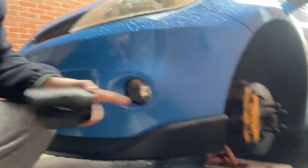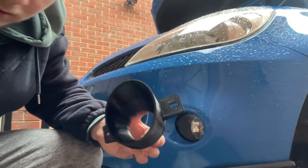That's the front wheel studs done. Can't do the back yet — need to let the loctite set at the front before we put the wheels back on. So while we're waiting, we're going to have a look at the brake ducts. All they do is bolt in place of the fog lights — you take the fog light out, bolt the duct in where the fog light goes, and then attach some ducting, which we have here.